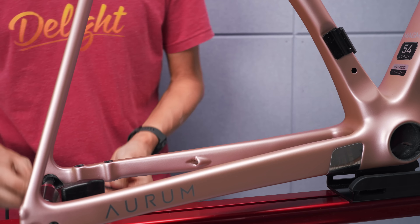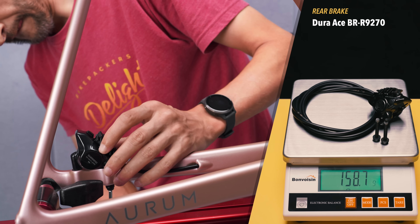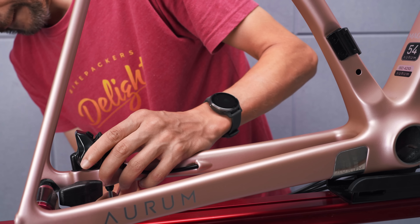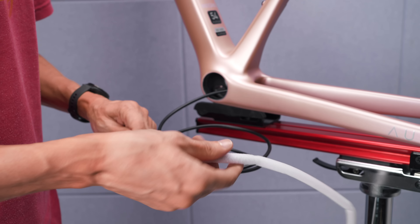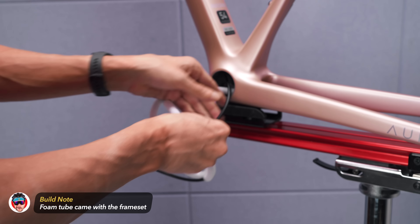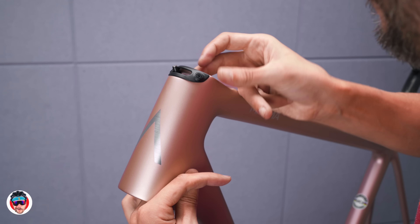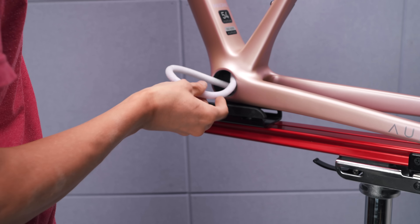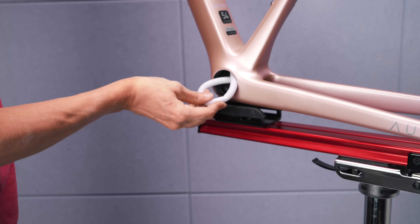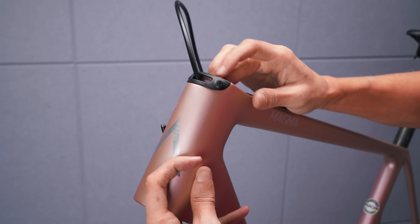Next, getting the brake hoses routed through the frame. Since these were bought as a shift lever caliper kit, the calipers come pre-installed with hoses and even filled with brake fluid. The hose ends are plugged so you don't lose any of that fluid until they are cut for the final fitting in the levers. The hose was easily pushed through the chainstay and out the bottom bracket, where I put on the foam tube that will help with any possible rattling noises. Then a 180 back into the frame, up the down tube, and eventually out through the hose port on the front of the head tube. No cable routing tools were needed here, which was good, as it would have meant cutting the hose plug at the end — and that would have been messy, as the calipers come loaded with brake fluid.